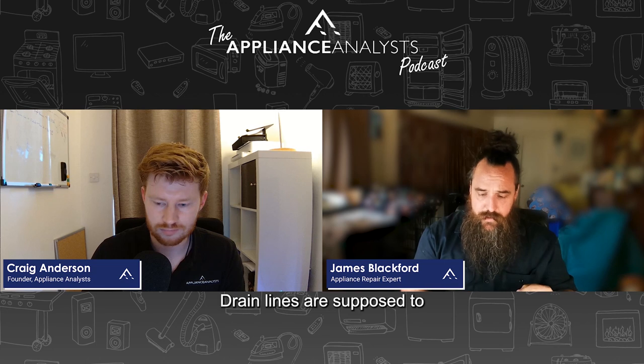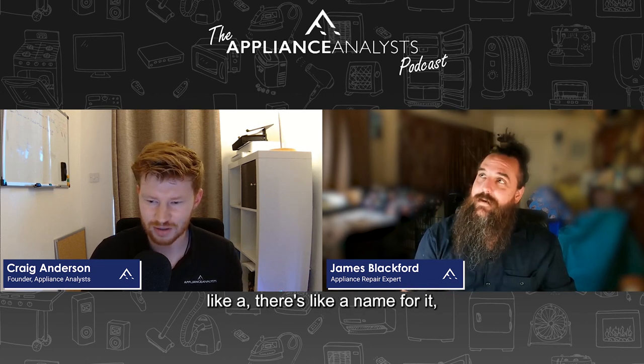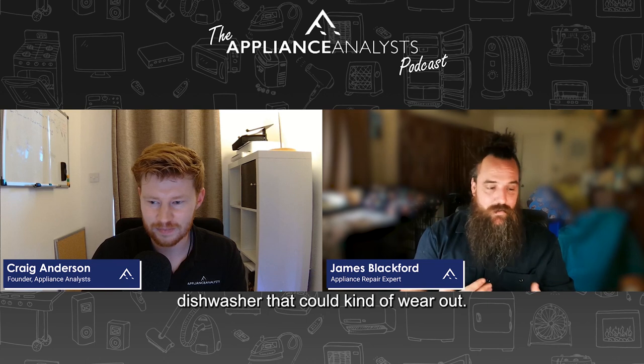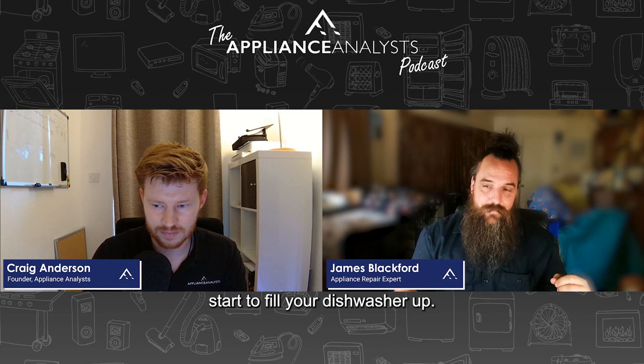Dishwasher drain lines are supposed to have a little rubber thing. I'm having a brain fart. Like a seal, there's a name for it. But essentially it's a seal, so water can only flow one way. Especially if it's an older dishwasher, that could wear out. So if the sink is constantly filled with a ton of water, it will eventually start to fill your dishwasher up.